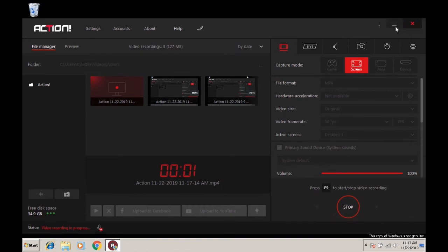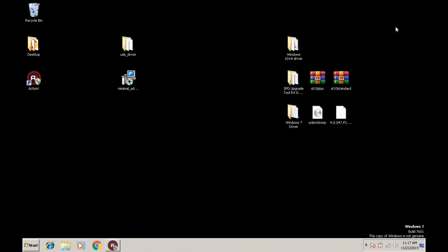Hi everyone, this is an update to the original video. If you do have bars on your screen, or you can't use your touch screen for some reason, or you can't see the screen, this is a method to flash stock recovery without needing the screen. Everything up to the TWRP flash is the same. So you should only be watching the end of this video if you have gone through the process of opening the research download tool and holding the button in the headphone jack and doing that whole flash process.